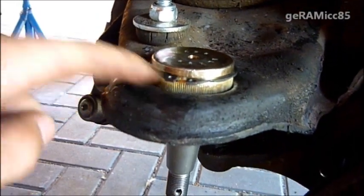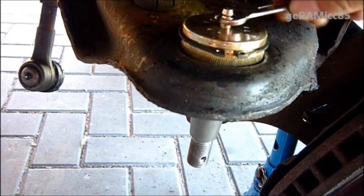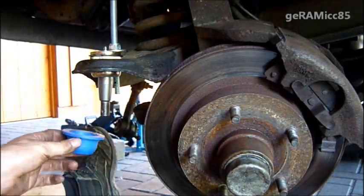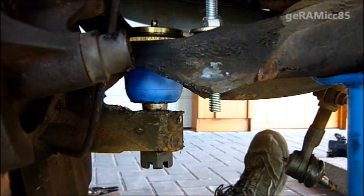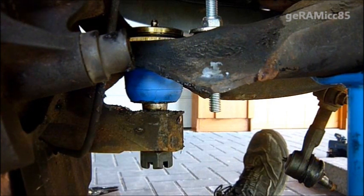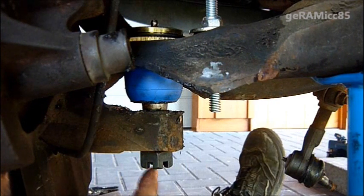I just put that safety ring around it and I'm putting the grease nipple on, because later when you've got the spindle back on it's kind of hard to get there. Don't forget to put the rubber on the lower ball joint. It's kind of hard to hold the spindle up and put on the lock nut with one hand — you could use a jack or something to jack the spindle up and then tighten down the lock nut.